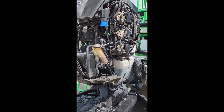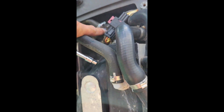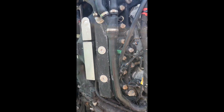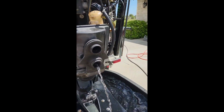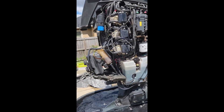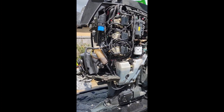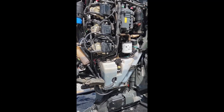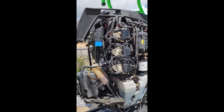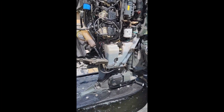We have water. That little blockage right there — that's what was giving me code 25, EMM temperature, and then code 29, and it shut down, and the engine was not even hot. Now I'm going to turn it off and put the thermostat back in there, and take it for a test run.